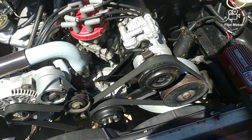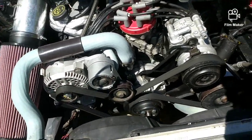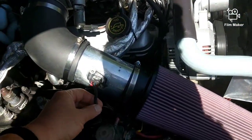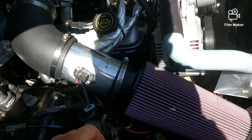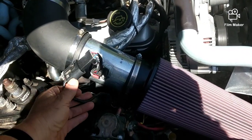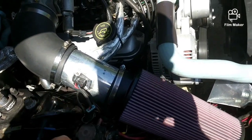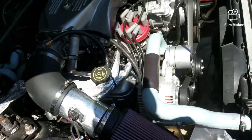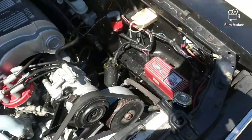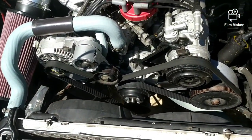Next up is going to be to put the Mark 8 fan on, and then maybe I can go back to the underdrive pulley. As you can see the slot meter setup - I had a little pigtail I borrowed off a 94 GT, and I've got a couple connectors so I'll pigtail onto that so I can run either the regular MAF or the slot meter. That's about it - just wanted to clarify what was going on, and hope you all have a good Mother's Day. Later.